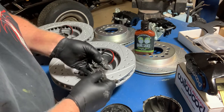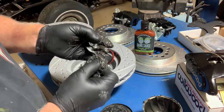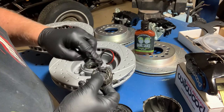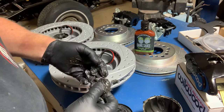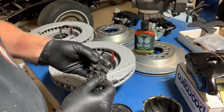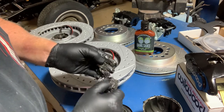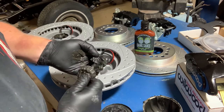When you're packing your wheel bearings, you just want to get some in your palm and pinch off just a little bit in that crack in the back. Eventually you're going to see it pop out the top and out the sides of the bearings. Never put these things in dry or just smear grease on the outside — you'll heat that bearing up and not make it to the ice cream shop.